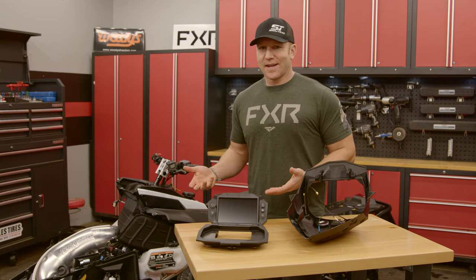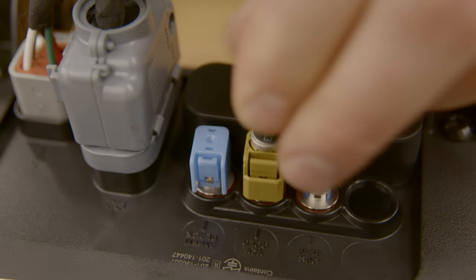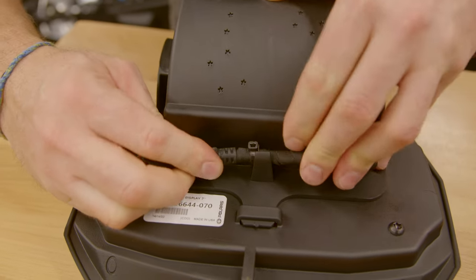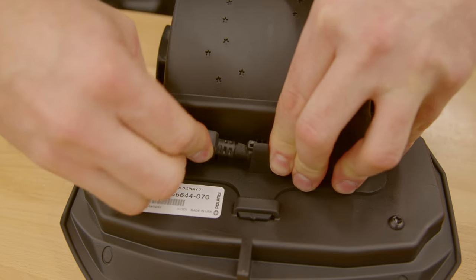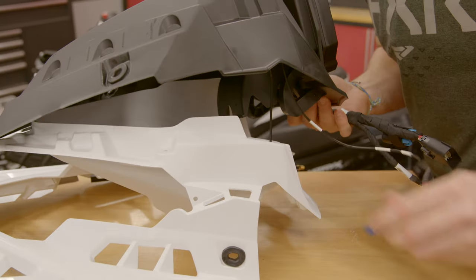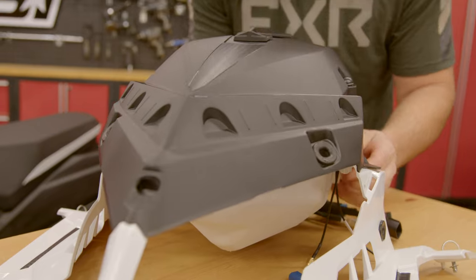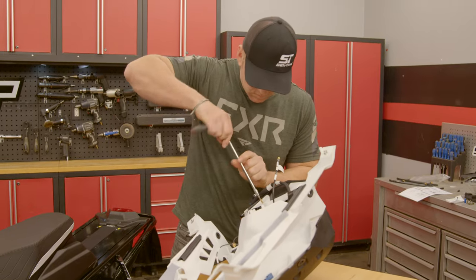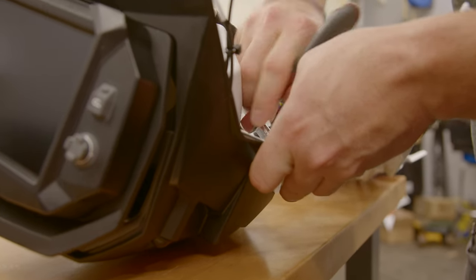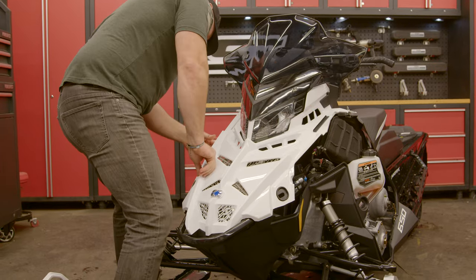I mean, it can't get simpler. I'm going to go ahead and attach all the necessary cables to the back of the screen as well as route the USB cable through the supplied fasteners. There's also a cool easter egg on the back of this wire plate with the stars and the Polaris logo. I drop the assembly door into the hood pod, connect a few wires, then put the hood pod back onto the hood assembly and rebuild the hood and headlight and drop it back into the sled. The wire harness matches up perfectly to the stock connector under the hood, so you're ready to reassemble and plug and play this new hardware. I button back on the hood and side panels and we are ready to rock.